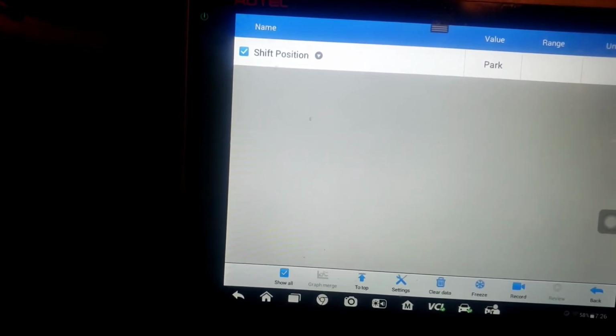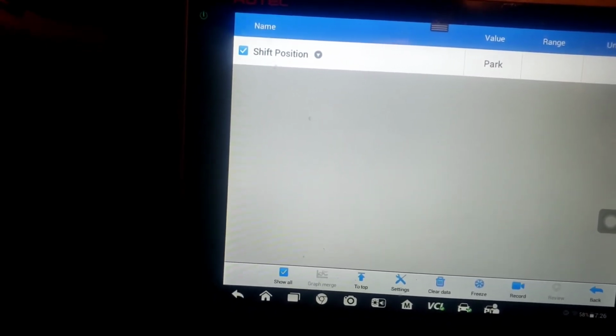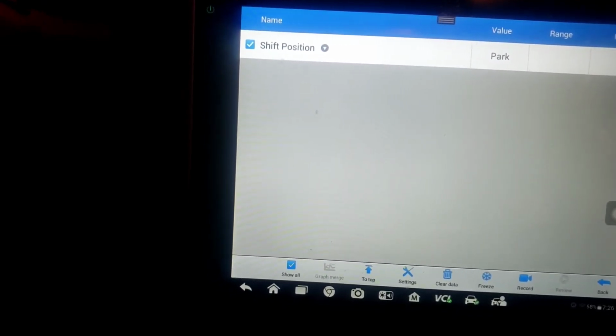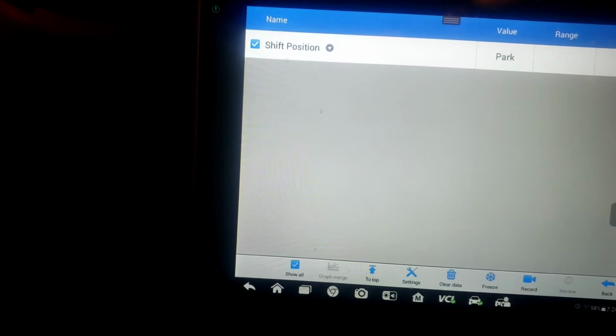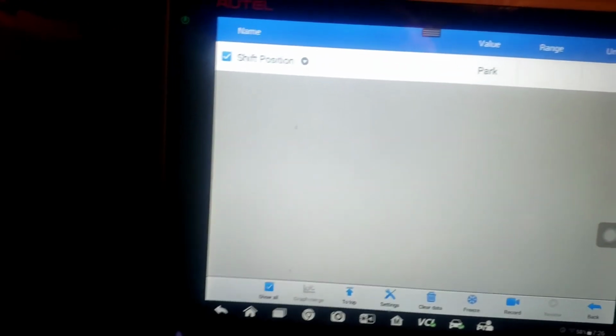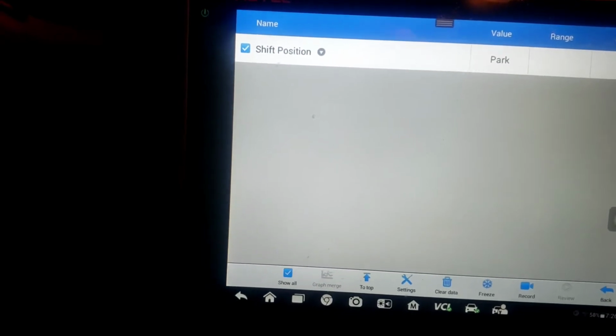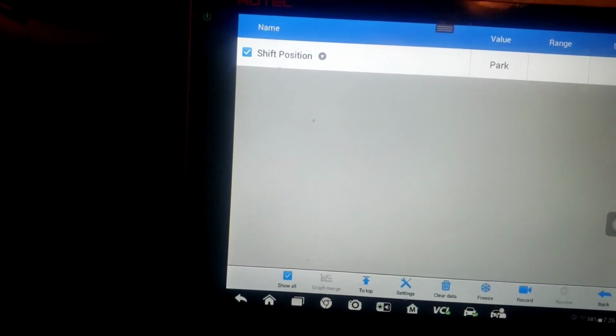We've got to adjust it, or get a new cable perhaps. I don't know if it was routed wrong, like I said, or it looks like it's just got this zip tie, twist tie looking thing that's holding it in there, which is not right, I don't believe. So I've got to look into the service manual for that. But obviously the mechanic had to have all that apart to disconnect the transmission. So we've got to fix this, because otherwise this thing will roll down the hill.